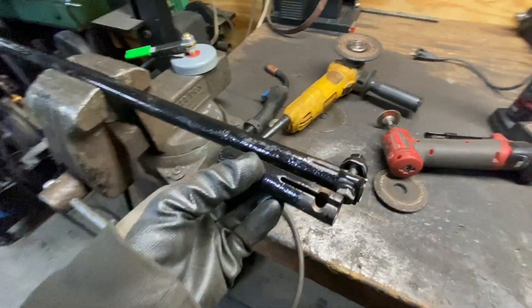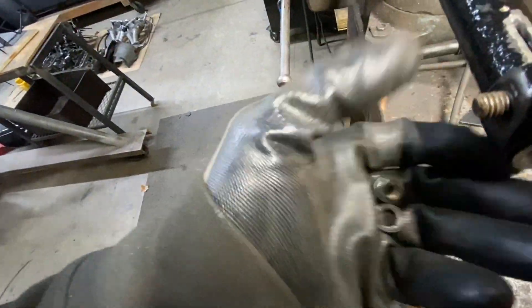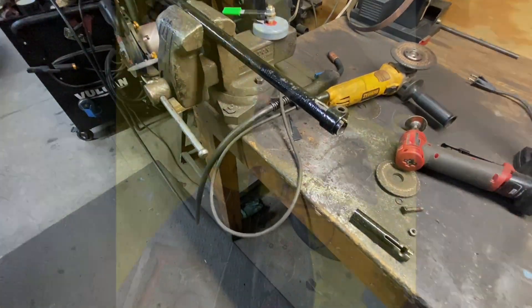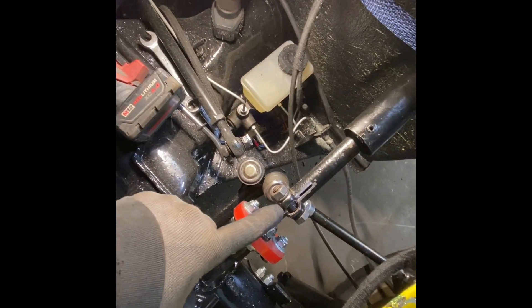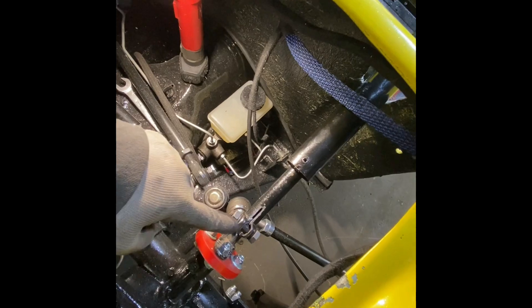Here it is — just replicated the shaft end. It looks pretty good. The shaft is cut, and now we're going to fit it back on the car. After cutting the shaft I upgraded the clamping bolt — I cut a new slot in the shaft and put in a much larger grade-8 bolt, about three-eighths inch. This way it will never come off. When you modify original parts you have to upgrade the fasteners — the original is proven but your modification is not.